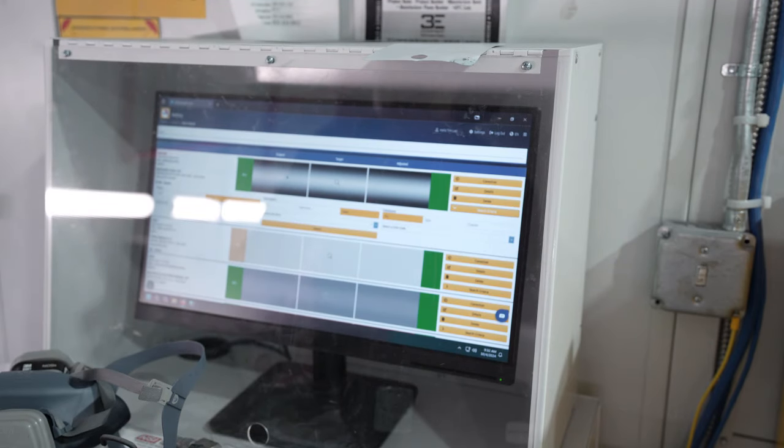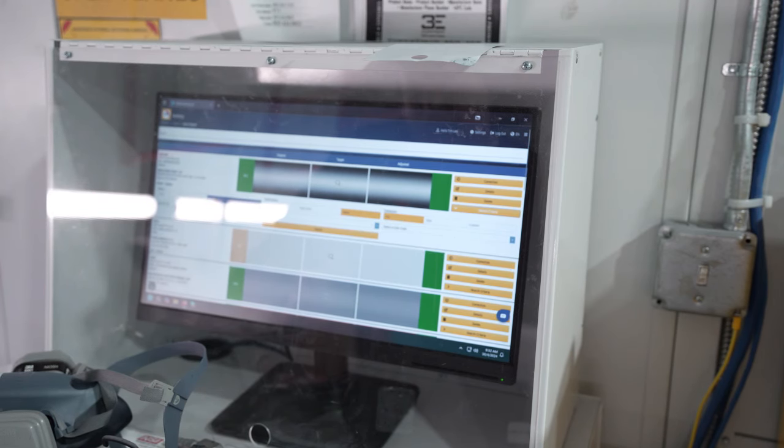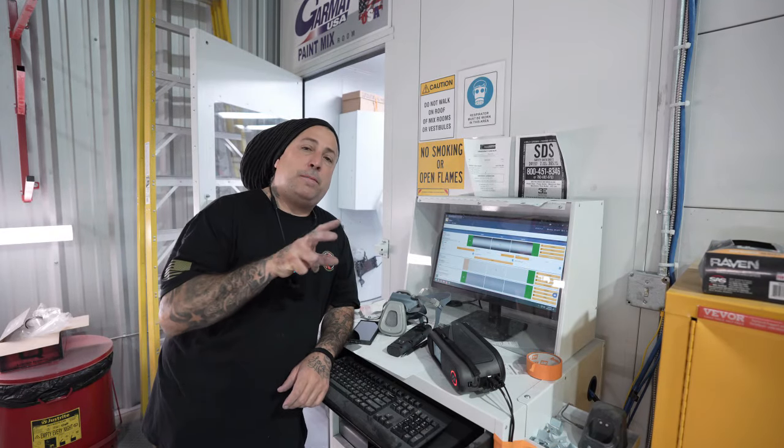All right, so we went ahead and we loaded it in, and you have your effect. Obviously, this is a metallic, so we hit metallic. Then there's a section here where it says matte. So we went ahead and hit matte. We put Mercedes and we searched it, and it gave us an 86, which is gonna work out well for that color. And it's funny, it picked the darker. So there was a standard and there was a darker, and this is a service formula here. So this here FI means service formula darker. And we've got an 86 match, even on a matte finish. So that's gonna be a nice point to know that that camera will pick up some of these matte finishes.